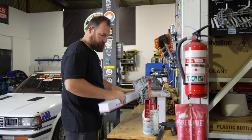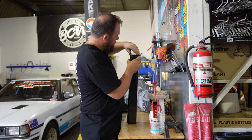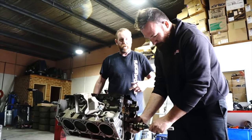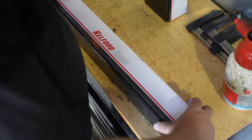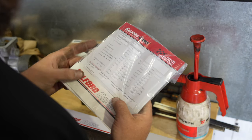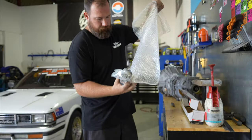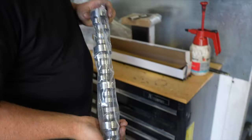I'm going to go with their lifters too by the looks of it. And the magic stick — that's the one Ian refers to as the whomp stick. At least with it being upside down, you're not pulling on the thrust side like it was still in the car. That's why it's always safer to roll your Commodore over when you do your cam at home. I haven't actually read a Kelford cam card before, but it actually lists all the other parts to run with it. All laser etched part numbers — a lot of cams you see are hand engraved and sometimes you can't even read them properly. These guys are all laser etching.